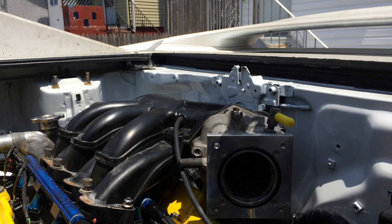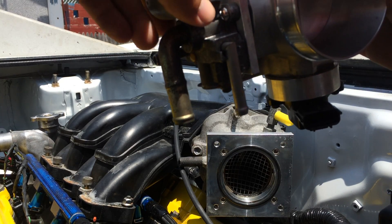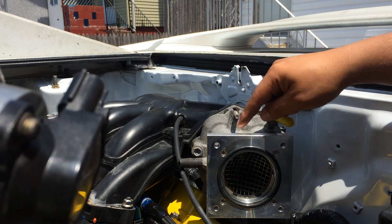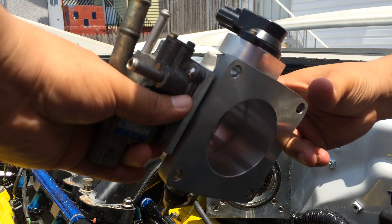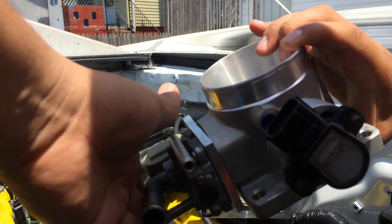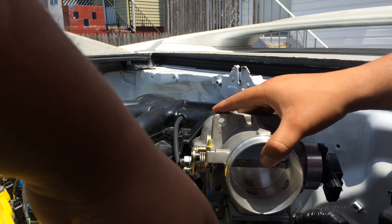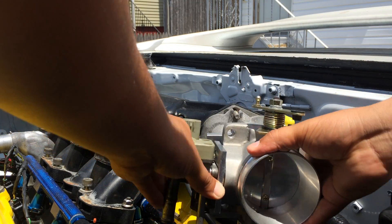I decided to go with a MAP sensor because a mass airflow sensor is a bit more expensive. I bought this from Racer X and I had to send him his intake manifold from a 3MZ so he could make this plate, which lets me adapt this intake and keep my 3S TPS sensor and my idle air control valve. When I first thought about this I wasn't assuming it was gonna hit the head, but it does, so because it's perfectly squared you just mount it on like this.